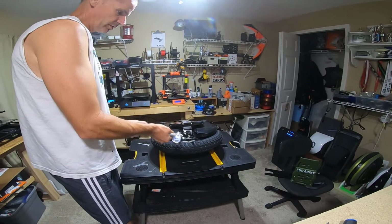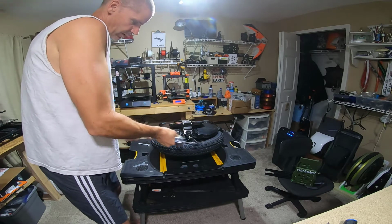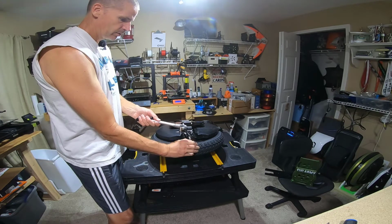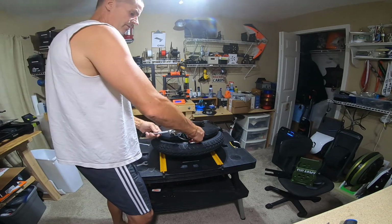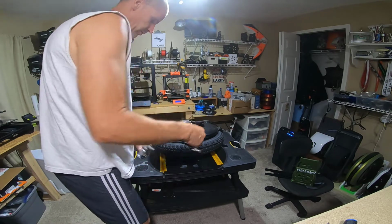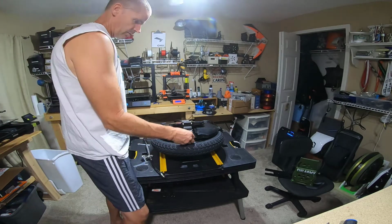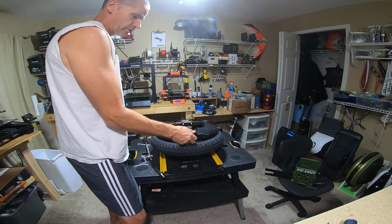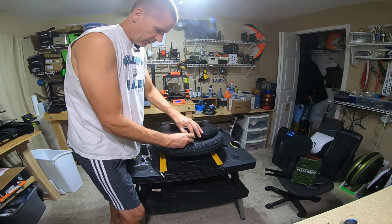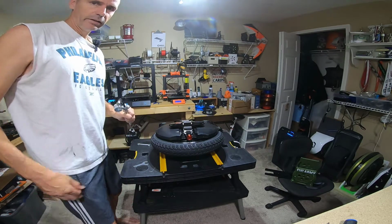As I'm doing this, the suspension is rising as it should. I'm going to put about the same as I had in there before. Looks good. Push the valve back down to disconnect. And you still want to try to turn it off as quick as possible. Okay, there we go. Put these less than impressive valve cap covers back on. And there you go. Just make believe I had a new shock. We just replaced it, guys, with not much effort at all. All right, I'm going to put some air in the top and call it good.